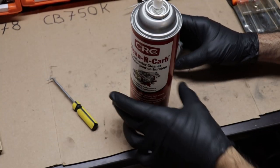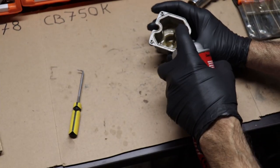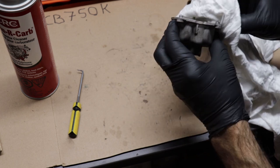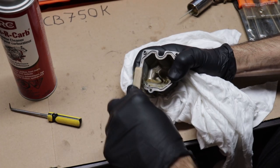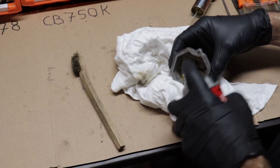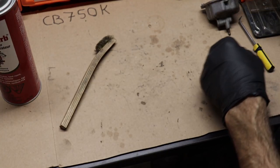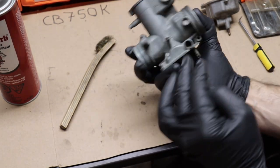So the cleanup begins. The original idea was just to clean the carburetor by hand, install a rebuild kit, and get the bike running - and that would determine the course this project is going to take. You can see I've removed the o-ring and I'm just using carburetor cleaner and a pick to remove the last little bits of sealant out of the o-ring groove. When we put this back together with our new o-ring in there, the last thing we want is the carburetor leaking fuel from all over the place.